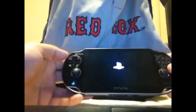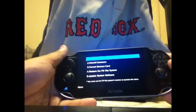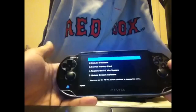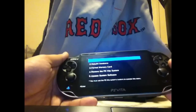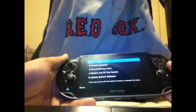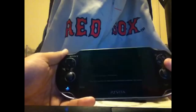You see that turns it on. This is going to automatically bring you up to a sub-menu. It says: Restart PlayStation Vita, Rebuild Database, Format the Memory Card, Restore the PlayStation Vita, and Update System Software. What you want to do is just select Restart PlayStation Vita — that's all you need to do.